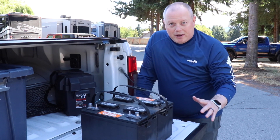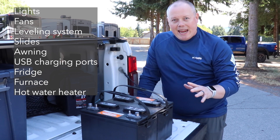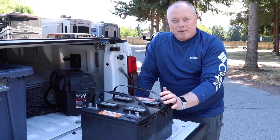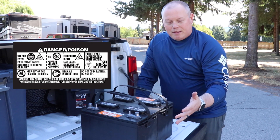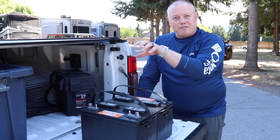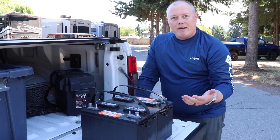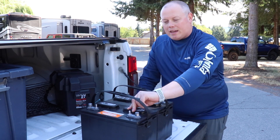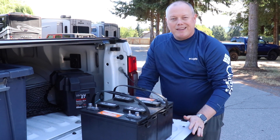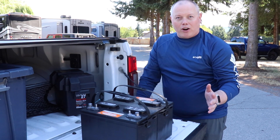When we're talking about all of the things connected to your RV's 12-volt system, 80 amp hours is really not a whole lot of energy. You'll see the labels — danger, poison — these things have to be vented. There are hoses that go out; you'll usually see a vent on the side of your RV to get out the gases these things put off. And you have to keep distilled water with you, popping the caps off and making sure they have a sufficient amount of water inside. That's just one or two more things added to the list of things you already have to maintain in the RV.